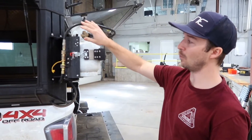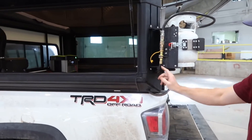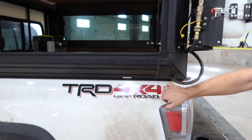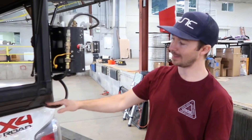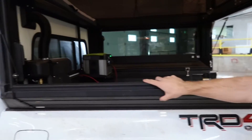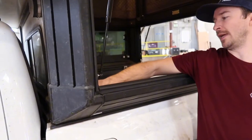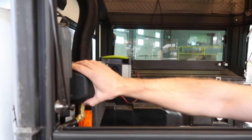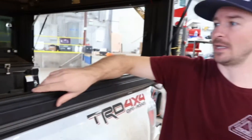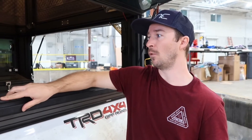The next thing I'd like to talk about is how we routed the LP line through the camper. It just runs up and then we put a hole in these base bracket covers — we can do this either with a new purchase or as a retrofit. The propane tank line actually runs internally through this big base profile, so it's not going to be in the way of your build out. It's really sleek. It pops back up once we get into the base bracket over here and then tees off and feeds the Truma. It's completely out of the way — you wouldn't even know it's there. It keeps the simple and functional aesthetic of the M1 intact.